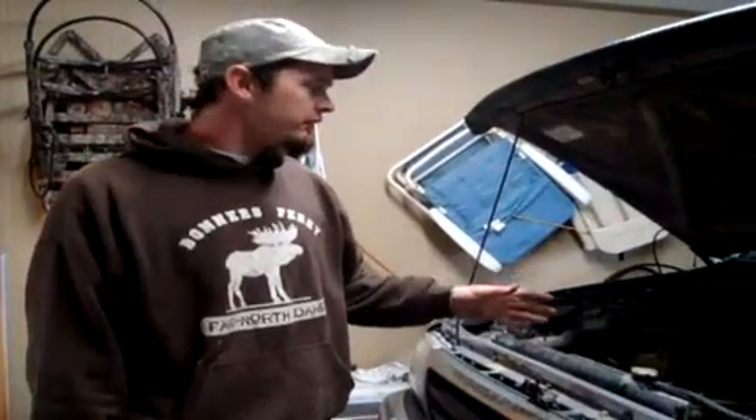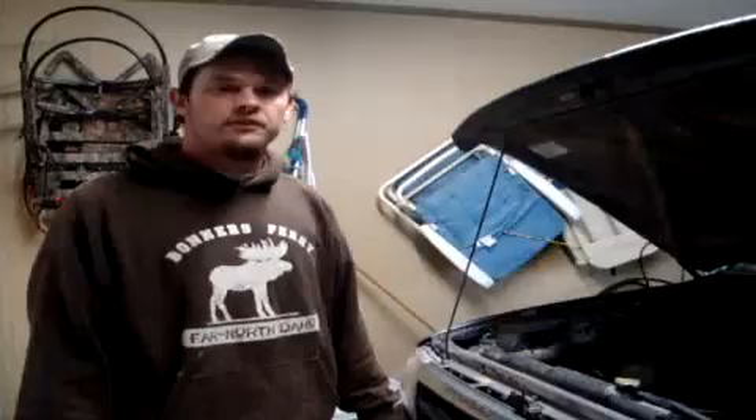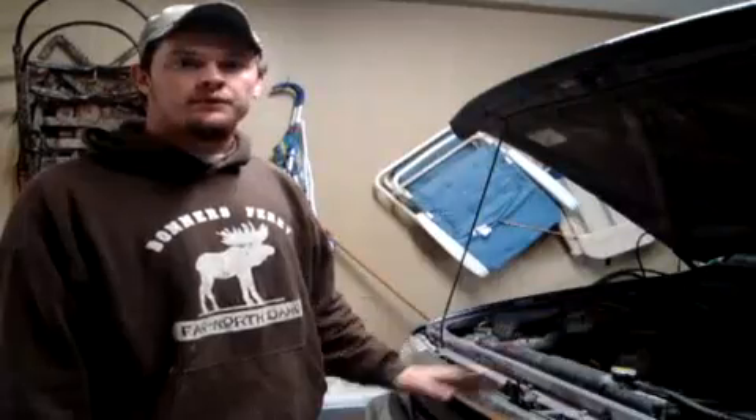Hopefully this will help you guys out. We're all done now. We took it out for a test drive and everything works fine. The reason why we did this today is it had a really bad shimmy — the engine was shaking and missing, and you could tell that something wasn't quite right. So I figured it was probably the spark plugs or the wires. So we changed everything here. And I'll have my dad start it up for you so we can see if the engine runs really smooth.